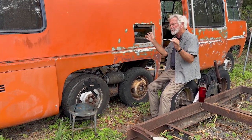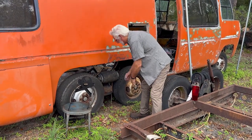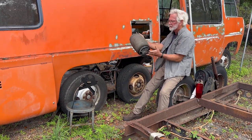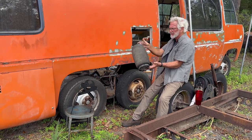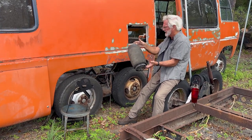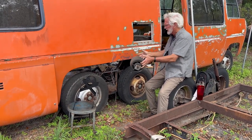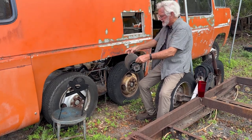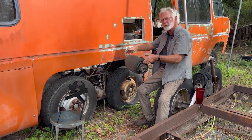Right away, everybody came out with a raft of airbags with brackets on the sides and stuff. But see, the reason that this airbag was used and so special is there's a roller on each side. None of the other airbags did that. Some of them had one — I showed you in another video — but this was a unique airbag. And if you replace this with a bag that doesn't have cones on it that goes from side to side, that's too much lateral movement.